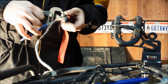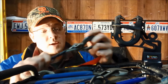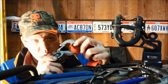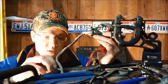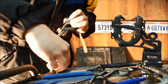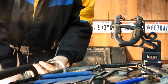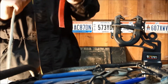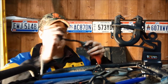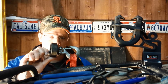I'm going to put that back on here. There we go — that's back on nice and sturdy. This is the grab hook; in case you're in the mud it makes it easier to find, but for plowing it's on the front. You'll notice I tied it around the front of the quad. Make sure you do it in a spot where you can take it back off without it getting stuck. Also, if you've got a stopper, make sure you put it on before you start your work — that'll keep it from getting overstressed when it hits the front.